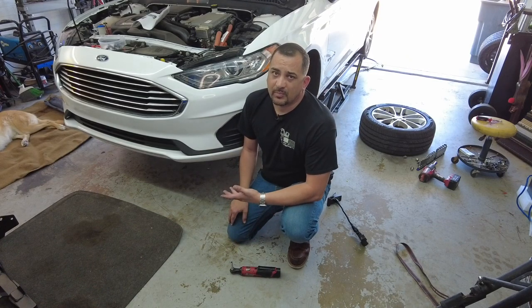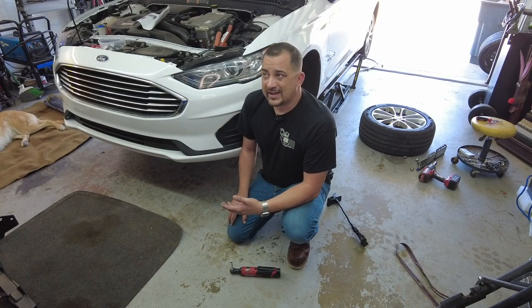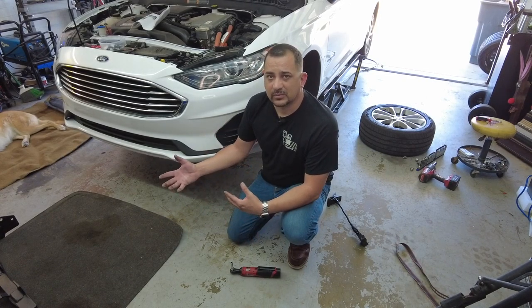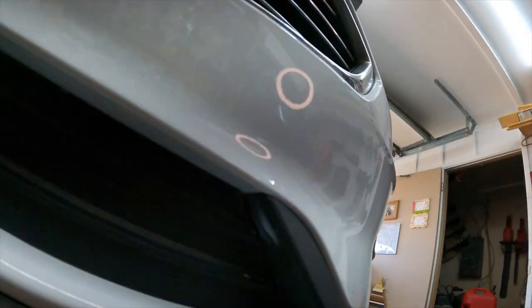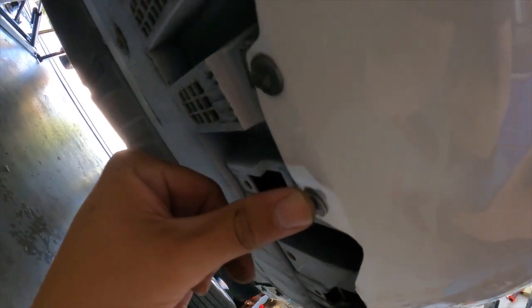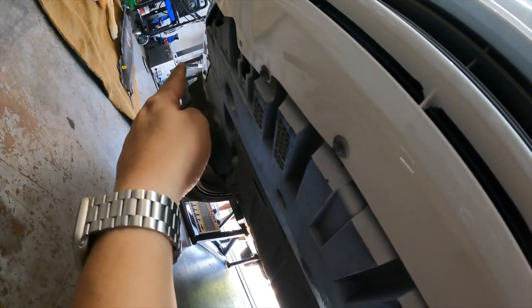This is why I put the car up on the quick jack. You don't have to — you could use a floor jack with a jack stand, or possibly get under there without jacking the car up because it's not super low, but I would recommend it. Coming down underneath the car, you have two bolts on each side and then eight along the front. Once those seven-millimeter bolts are out, you're going to grab your infamous 10-millimeter socket — there are eight more 10-millimeter bolts to pull out underneath.